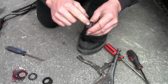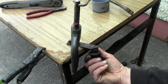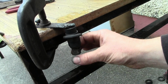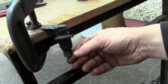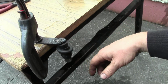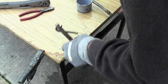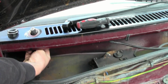So now I'm going to have to weld on the arm to this. So what I've done is I got the better one of these and I've welded it onto the old arm, because there's no way of pulling off this. I wouldn't really have the heating tools and stuff to pull it off, and it's well fused together, the spindle. So replaced it at the bottom. Remember, it had broken there fairly recently before, so I'd been in welding. So then I cooled it off very quickly so as not to melt the plastic. So it just fits up again under there.